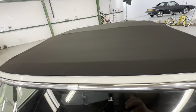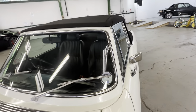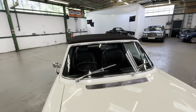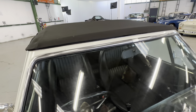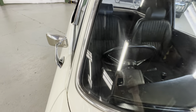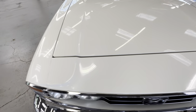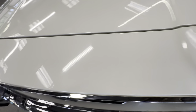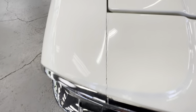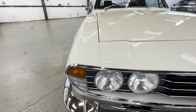Around the bottom of the windscreen — with it being white you'd see any rust or corrosion from ten paces back, but that's not the case here, all lovely and tidy. Normally on these Stags we find quite heavy delamination on the windows, but not on this one. Coming back down the right-hand side of the bonnet onto the front nose cone, there's a little bit of paint shrink on both sides, though not really noticeable until you're up close.